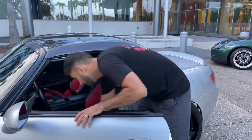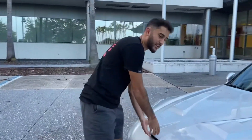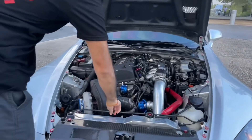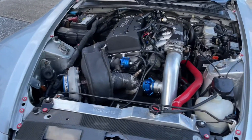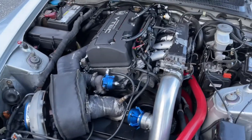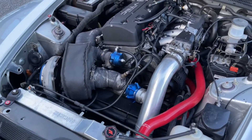Let's pop the hood and show you guys why this is 600 horsepower — not dyno, but close. The prop isn't working right now. We're running 1600cc injectors with the CX Racing turbo kit, Tial wastegate, and blow-off valve. It's a pretty good setup.